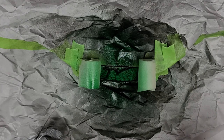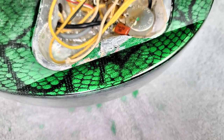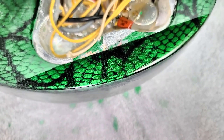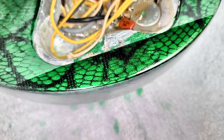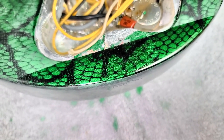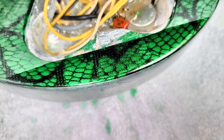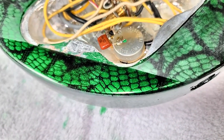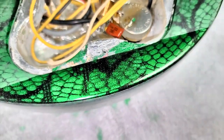I'm going to let that dry and hit it again until it gets about as dark as the edges, and then I'll blend that in with wet sanding. She looks pretty good — not too bad. You have to understand the body has a clear coat on it and this does not, so it looks a little dull sprayed right out of the can. Once it dries I'll blend it in with wet sanding, hit it with some clear using the same rolled tape process so I don't build up a hard tape line, and then smooth it in with buffing. The whole thing matched up pretty well with the webbing or lace.